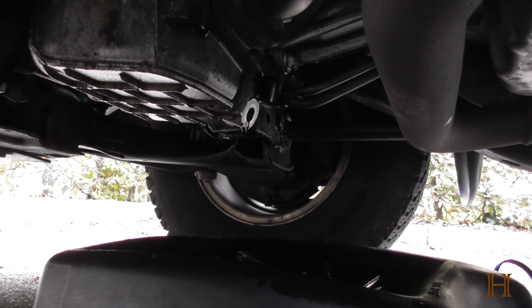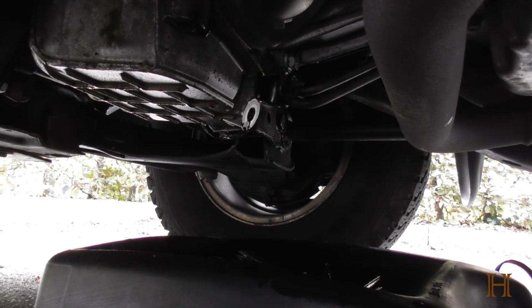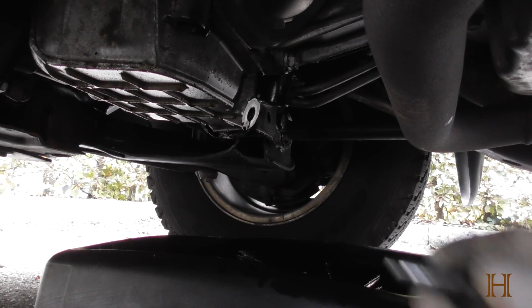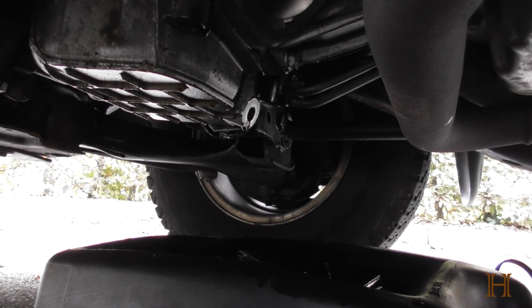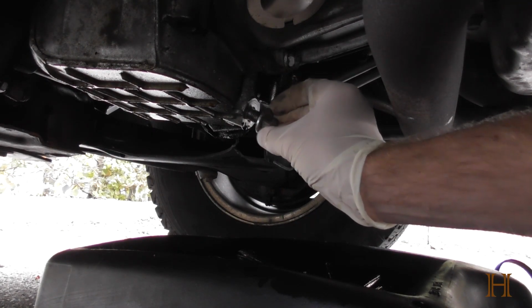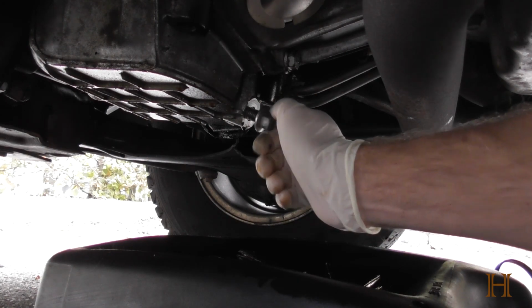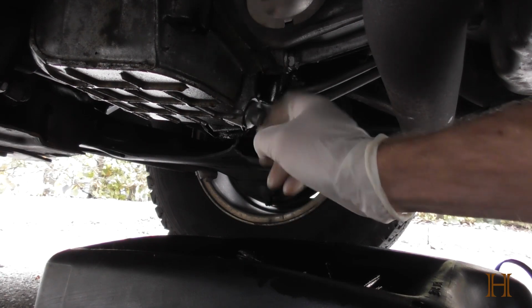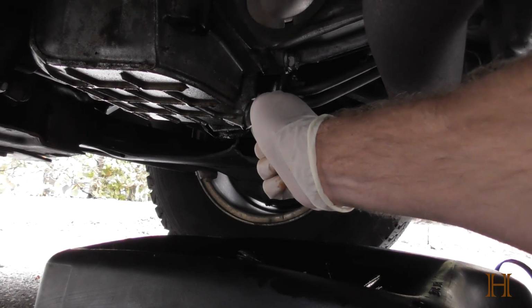Okay guys, now once your oil draining has subsided to a dripping, you can go ahead and put in your oil plug again. It's never gonna fully empty out all the oil that's actually in the oil pan and in the engine. You basically, I think, get like 95% out, something like that. But anywho, just take your oil plug, put it back in nice and straight, start threading gentle, do not cross thread it, and first finger tighten it.